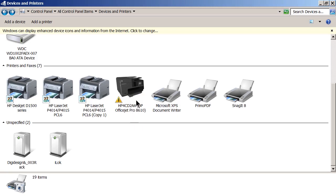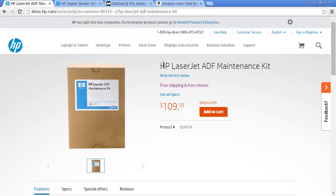A device like this can usually do about 10,000 pages before you really have to maintain it. Laser printers — and I've historically been an HP guy, I use a lot of HP printers — work essentially the same way with other manufacturers. These laser printers might be able to handle 50,000 to 100,000 pages before they need maintenance, or you might want to maintain the printer every year. To do that, you want to get yourself a maintenance kit.